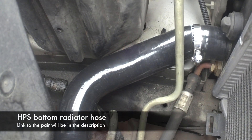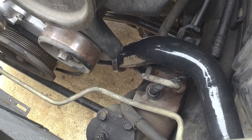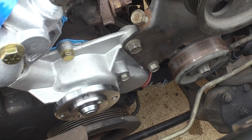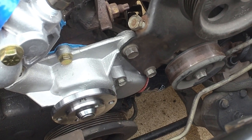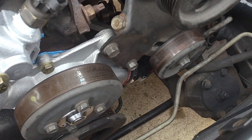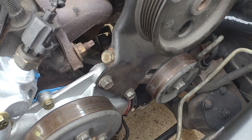We've got the bottom hose on — actually the fit is pretty good. It bends down around, goes under these pulleys, conforms nicely, comes up snug onto the water pump. I'd have to say I'm really pleased with the fit. I'll leave the links in the description. I just need to work on getting the hose clamps into a position where I can reach them again if I ever need to take these off. The bottom hose was a little challenging because I had to get under the car to position the clamp so it wouldn't potentially contact the serpentine belt.